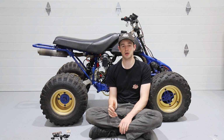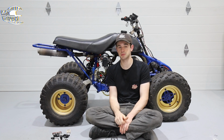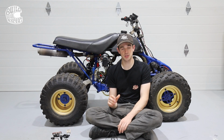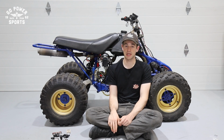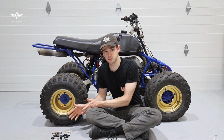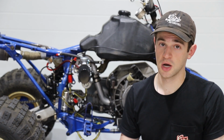In the last video, y'all saw us install this GT15 turbo that was machined and sealed by G-Pop Shop. The only thing was that we're still pushing way too much oil pressure through, so it's still leaking through the seals. And that's why we have this regulator and all these parts over here, we can finally get this thing solid and not leak.